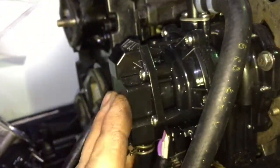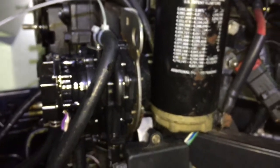If I have to go that route, instead of running the oil injection for the VRO I might just go with a regular fuel pump. You can look it up — for an '88 or '89 88-horsepower Johnson they use the same fuel pump on all these smaller engines. Even though this is a 130-horse, the fuel pump will be the same and it should mount right up to this VRO bracket, so you don't have to change the bracketry or any of that stuff.